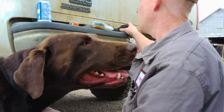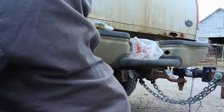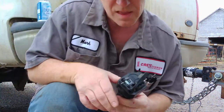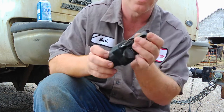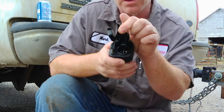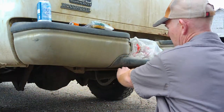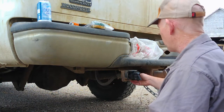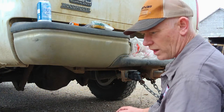The first thing we need to do is test to make sure we have lights. I had to get this adapter. This adapter will plug into my main truck harness at the bumper, and it's got an adapter here that'll allow me to run the four-lead harness. It can also do a six-lead one, but this is the four-lead that we need. So that will just plug into the main truck harness. Now this one is actually wired with the four-lead on the side here, but the wiring got ripped out of it years ago, so we'll just use this adapter into this harness where I know I have power.